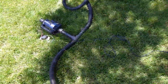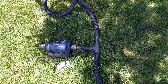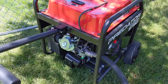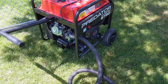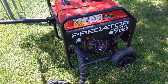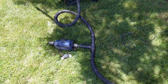The gas is going to come out here to a T, and this is where my startup fan is going to be. Once it gets going, I'm going to take the fan off and just use a piece of tape over the end of the pipe to get the air-fuel mixture right so I can run it into the engine. But before that, I'm going to run the engine until it runs out of gas — I've got the fuel valve shut off — just to make sure there's no gas in the carburetor, so that when it starts up it is running on the charcoal gas.